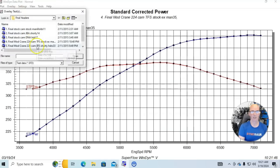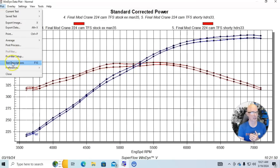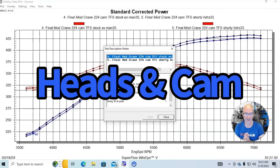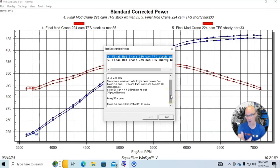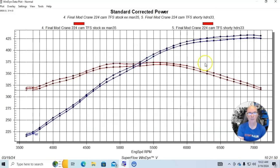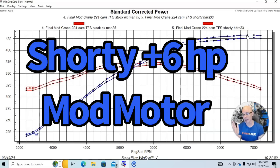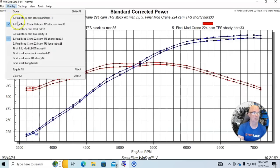On our modified motor we had a much larger camshaft — a Crane 224/232 cam with 590 lift — and we had Trick Flow 205 heads. This thing was making more power and required more exhaust flow. The cam was on a 115 degree LSA. When we ran shorty headers versus stock exhaust manifolds on the modified version, we gained about six horsepower — a little more than on the stock version, which is what you'd come to expect.